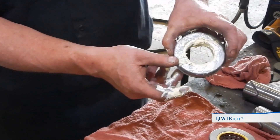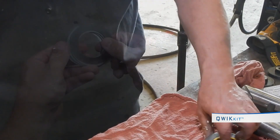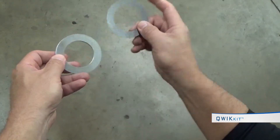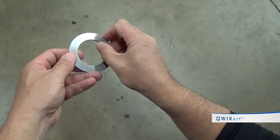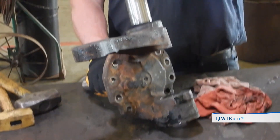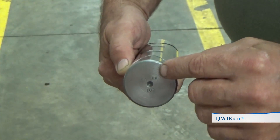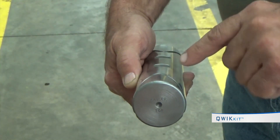Both bearings need to be pre-packed with grease — pre-packing the bearing will ensure maximum bearing life. Select shims equal to the amount removed plus one additional five-thousandths of an inch shim to compensate for wear. Place the kingpin through the upper spindle bore — note that the word 'TOP' is on the top of the pin and is aligned with the lock flats.